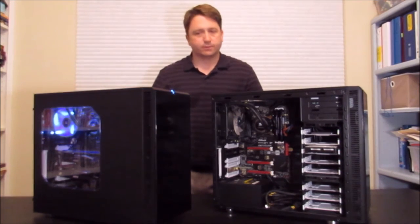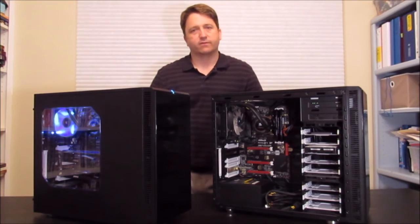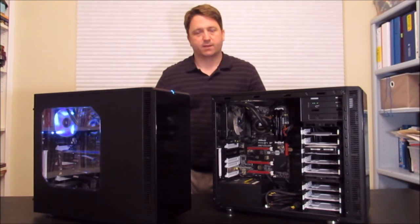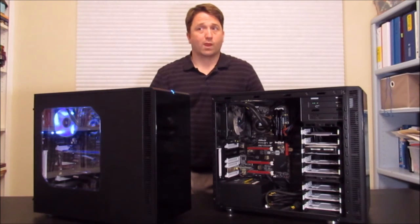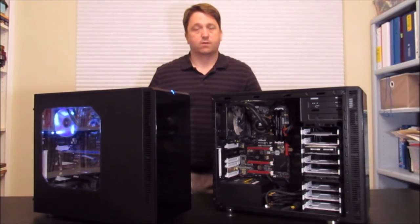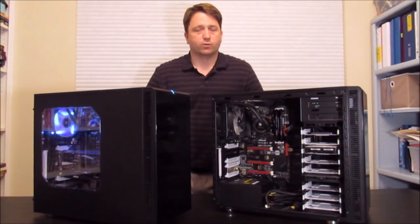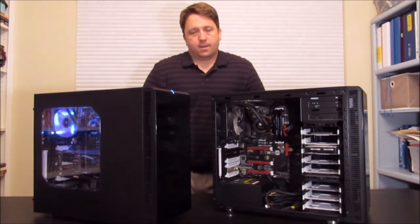Obviously I was able to complete all the tests and do everything I needed to do tonight, but long term I certainly wouldn't recommend only having a 750 watt power supply for this exact rig. The great thing about the 900 series GTX cards is that their power consumption is almost half of these — the GTX 960 pulls about 125 watts and the 970s pull about 145 watts. Significant power savings with the newer cards, which is something I really like about those.